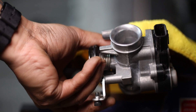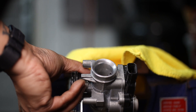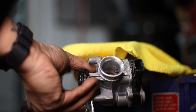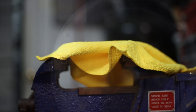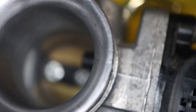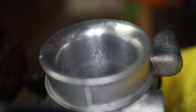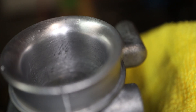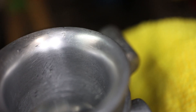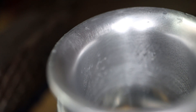Here's the final product. I really tried hard to make the bevel as even as I could all the way across and make it smooth. I kind of wanted it to be like a velocity stack, even though it's not really a velocity stack. I used the macro lens to get as close as I can and it is not perfect by any means. You can still see some scratching — I could sand it more, which I'm probably going to do off camera. The idea is that the flat side that was there now has a beveled edge for air to evenly flow across and not cause any weird turbulence on the inside.